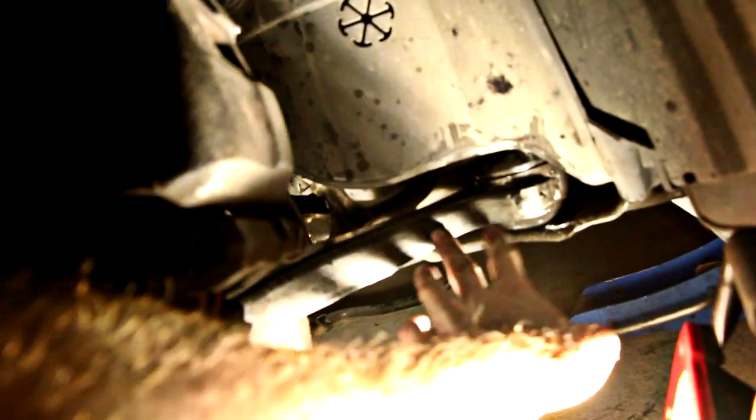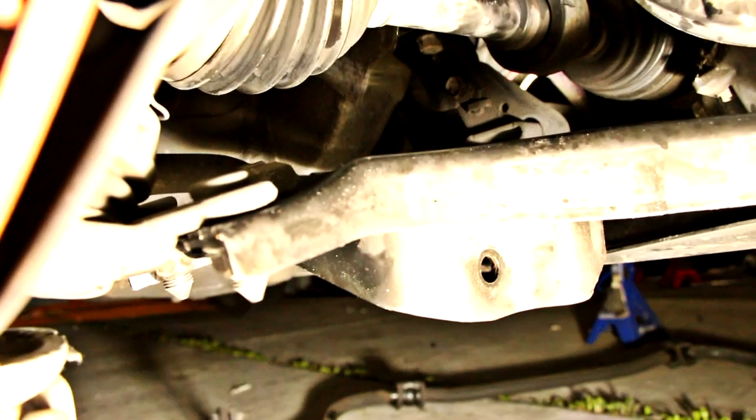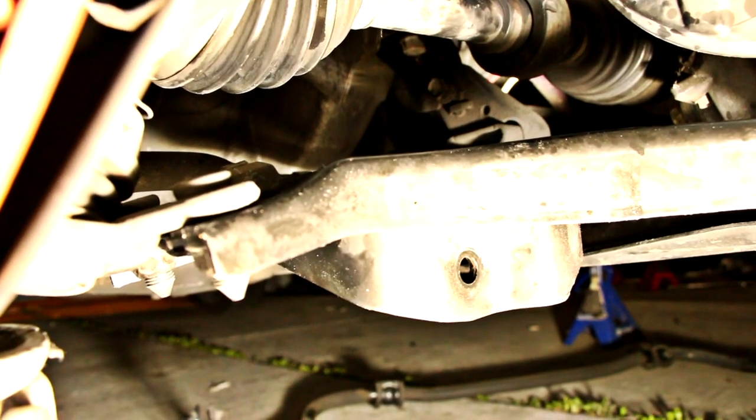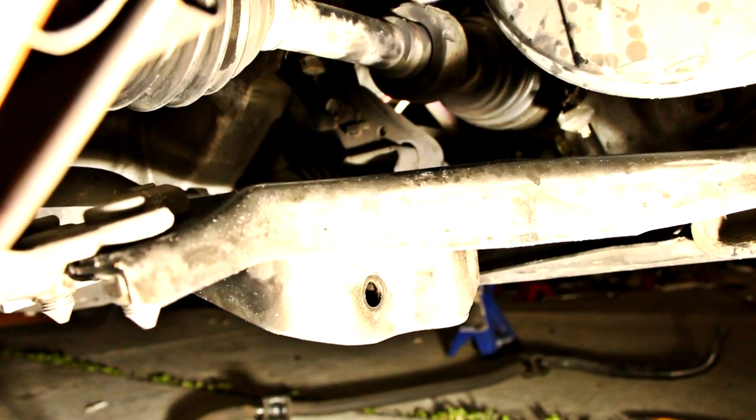The rear bushing seems to work just fine. A big thing about installing these bushings that you need to know — it's 100% necessary — is that the only way to actually reinstall the control arm in the chassis is to move everything out of the way like you did on removal, get the control arm in the chassis, and bolt it into the chassis before you do anything else. The problem is, once you do this, those new bushings are so stiff they aren't going to line up the control arm to the ball joint bolts, because you just cannot manhandle how stiff these bushings are.